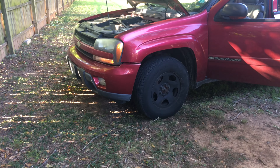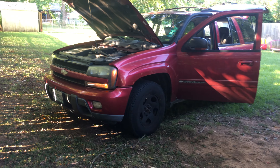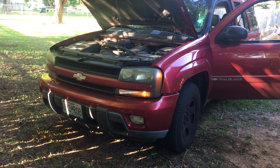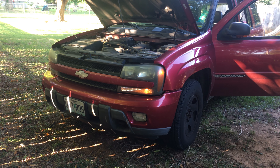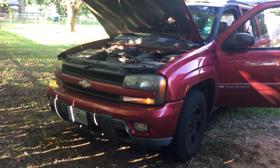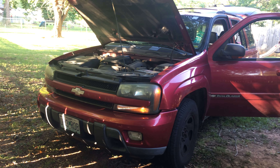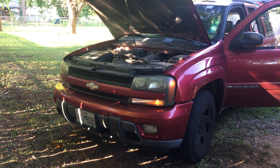This will be troubleshooting the headlights on your Trailblazer, Envoy, and the other variants by GM. When your headlights decide they want to turn off while you're driving at night and you can't seem to get them to come back on by toggling your headlight switch, you may have a bad solid state relay. The problem may be intermittent, as I have experienced. Sometimes the frequency varies by seconds, or they may remain off or on for hours without any predictability.